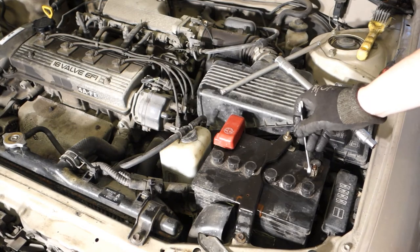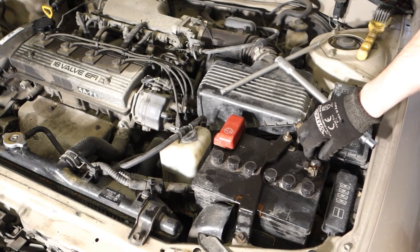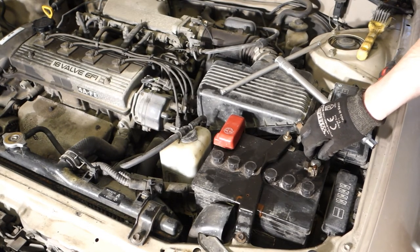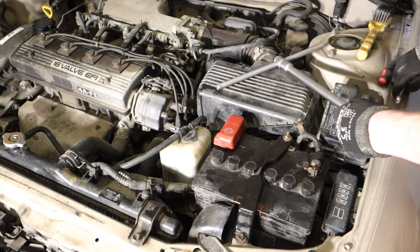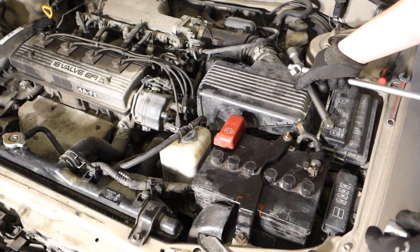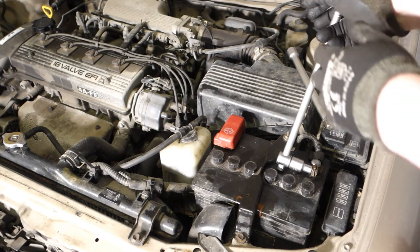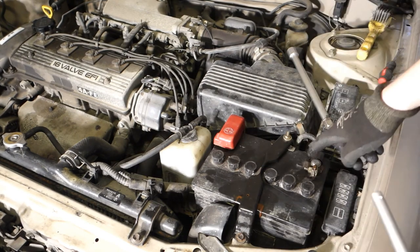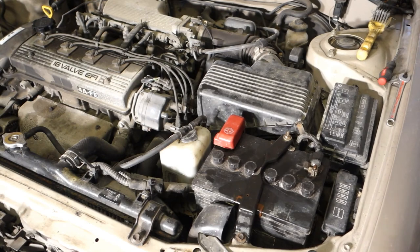And then I fasten that, and all the time I check whether it is loose or not, and it must be tight so that I can't move it. Then be careful, because there is a risk that if I use some tool like this, a long bar, and move it in two ways with two hands, then I can destroy that base. And be careful. Okay, now everything is fine, and now I can say that this battery has been serviced,